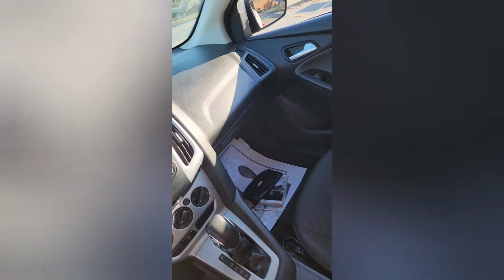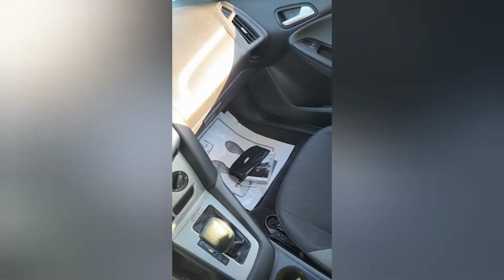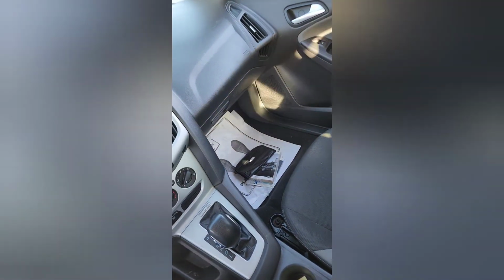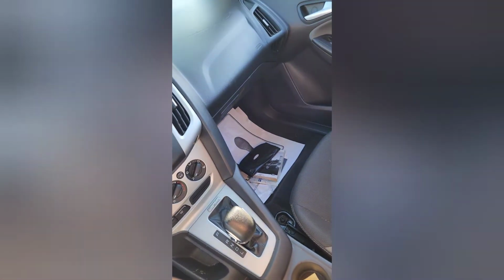But one quick tip, because I'm here about giving information. There is a ground wire that goes where you hook up the battery, where you hook up jumper cables at that ground. If you take that ground wire off and clean it, the TCM will start working better, because what they did is they painted that spot, and it's a grounding spot. And multiple people will say that.